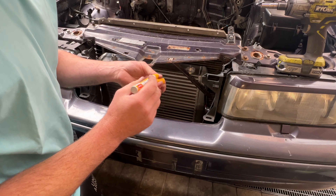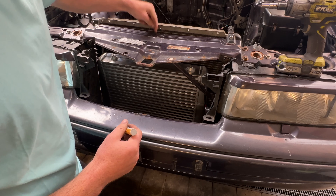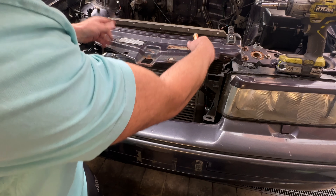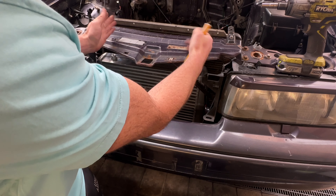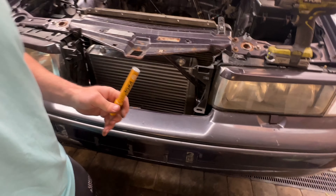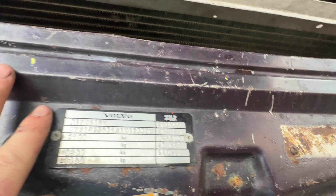It just measured 17.5cm — 175mm from the centre point either direction. So we've got 35cm, 350mm — that's the width between the bolt holes in the intercooler. So we'll be drilling the holes here and here, where the little marks I've made are on either side.